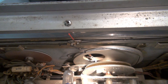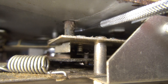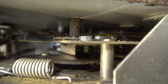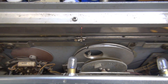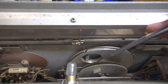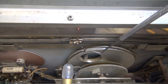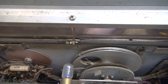I'm going to give it a shot and hopefully not remove that front panel. I was able to get in from the bottom with the dental pick and I put that cord back over the pulley. If I go on the top side and tighten her up, it may be ready to go. I think I actually got it — it's all back in place. Now it's really loose because the spring is not connected down here; this is what holds tension on it. So I'm going to take my dental pick, hook that on there, and see if that needle moves.